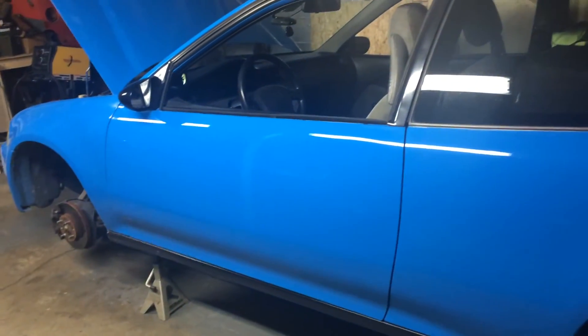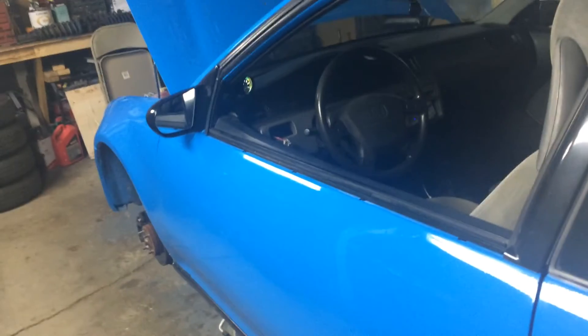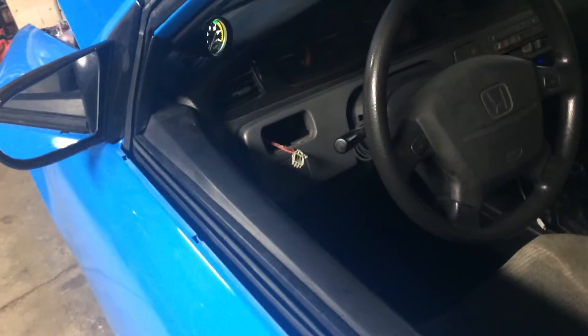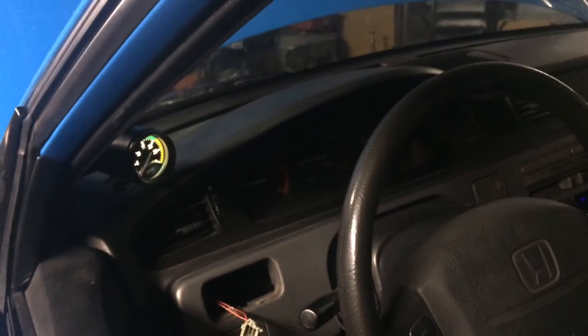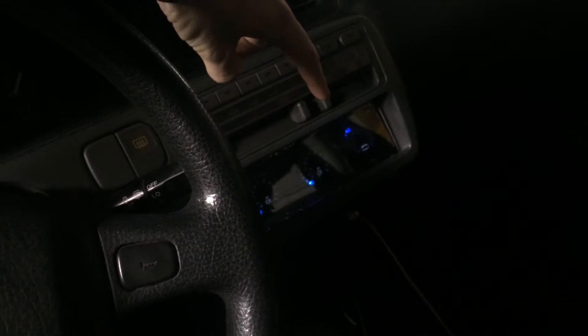I still need to repaint the black trim, and I got new pieces for those because the old ones have weird dimples. Also got the trim that goes up there, which was expensive. Inside, the light switch doesn't function correctly and the dash lights flicker. I did an LED conversion for the gauge pod because it was getting too hot — the gauge was rotating and falling out.